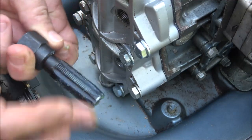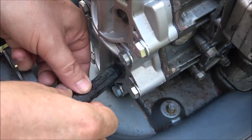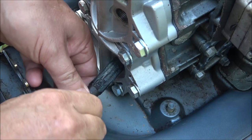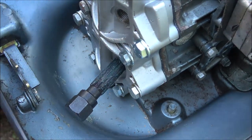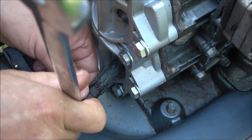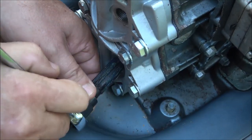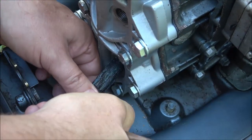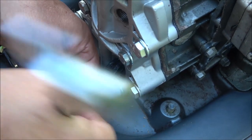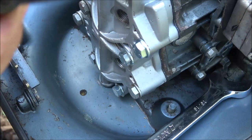We've got some grease on here. You can use a little oil — it also helps with the cutting process. The hardest part is getting it to start straight. We're going to go ahead and get this started — it's a little time consuming if you have to use a wrench; if you use a ratchet it's not as bad. It has to take away some aluminum before it even starts threading. I'll keep going until it gets started — see, it's starting to cut.